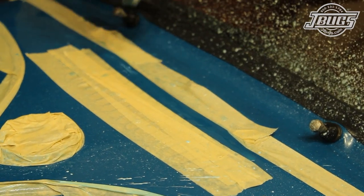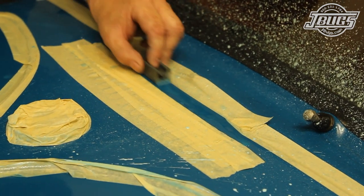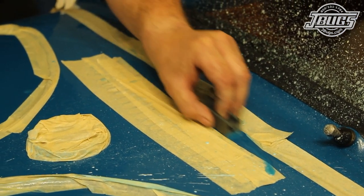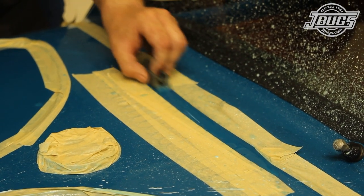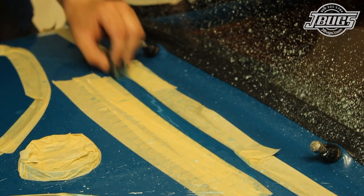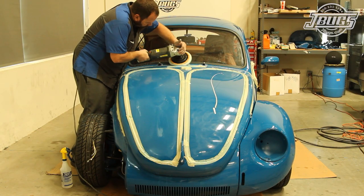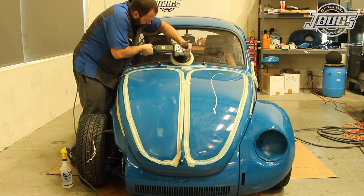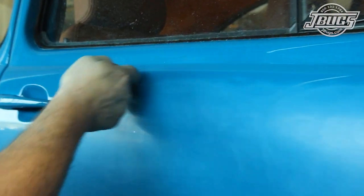For the sag behind the air vent, we'll use a small aluminum channel as a flat block for our sandpaper and sand the paint down in this tight area until the sags are eliminated. Resist the urge to use your finger or fingers to sand, as you'll sand a groove in the paint since your fingers are not flat. Once the sag has been sanded flat, we can cut and polish the paint here, being cautious to polish over the edge, not into it with our pad. Here on our door, with some natural light through a window, you can more clearly see the difference between the smooth sanded surface texture and the edges. This is what we're looking for: a blended transitioning area between the edge and the sanded areas.